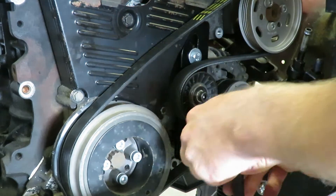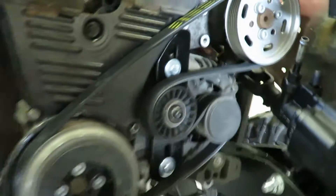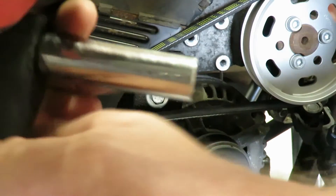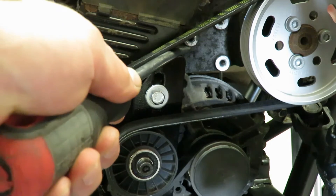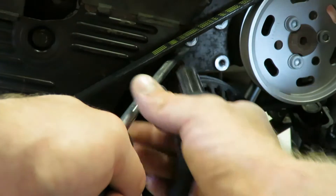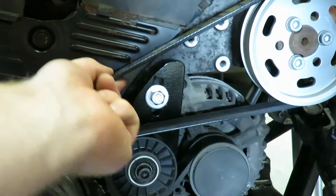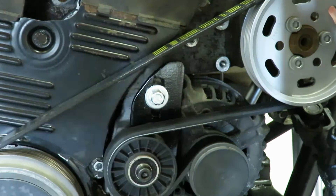Make sure your bolts are loose. What I do here is just take a screwdriver — just get a flat blade — and you can pry on where the original tensioner bolted on. There's that boss where the bolt went through — just pry on that on the top of the plate, get it snug, and tighten your bolts up. That should be tight enough. Pretty simple setup there.